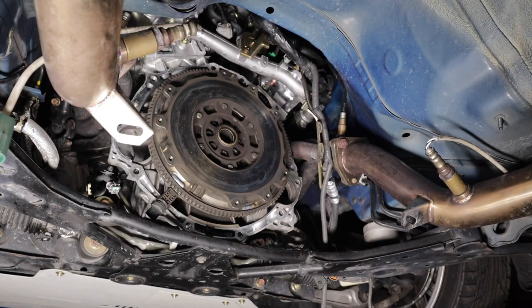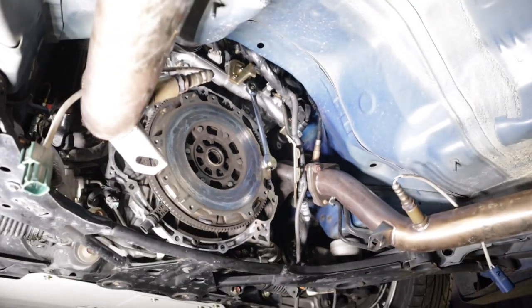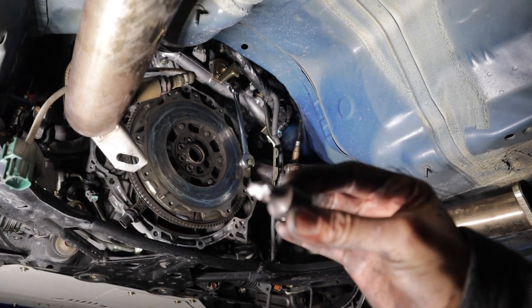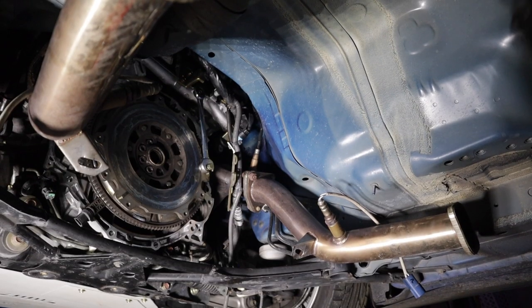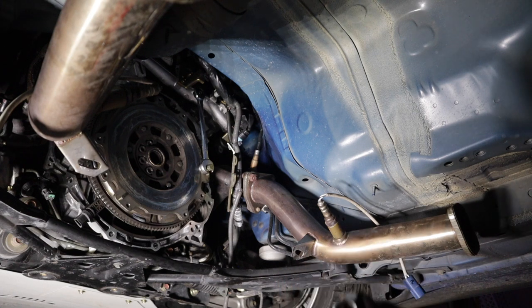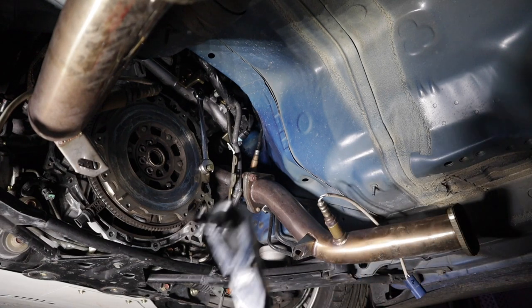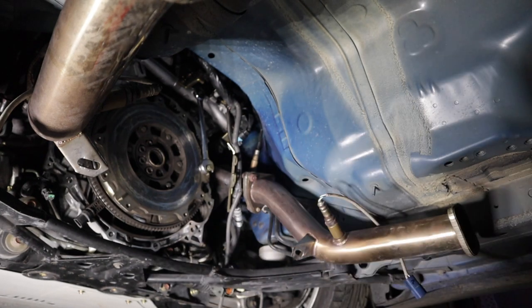The socket you're going to need is a Torx T55. What I did — probably not the best idea — is I got a wrench and put a bolt on the top and bottom to hold it in place so I can take the flywheel bolts loose. I ended up breaking my torque socket but I got lucky and found another one in a half-inch drive with the big boy wrench. I highly suggest using a half-inch driver — it made a huge difference. Already done with all three bolts.